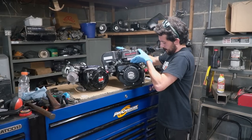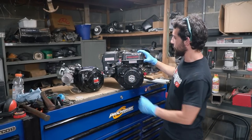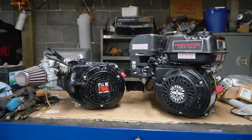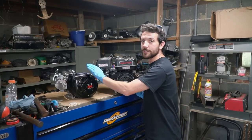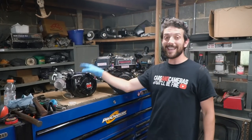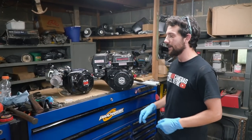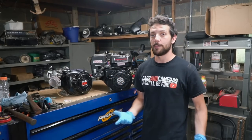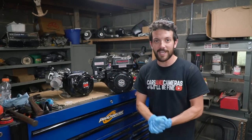Ooh. So here's the old power plant. Here is the new power plant. They're the same physical size and everything. They're both Honda clones. This is 212 cc's. This one is 225 cc's. It comes with about 18 horsepower right out of the box with the small carburetor option, 22 millimeter Mikuni from gopowersports.com. They are the sponsor of today's video. If you want to check out these parts, you can see them at links in the description of this video.